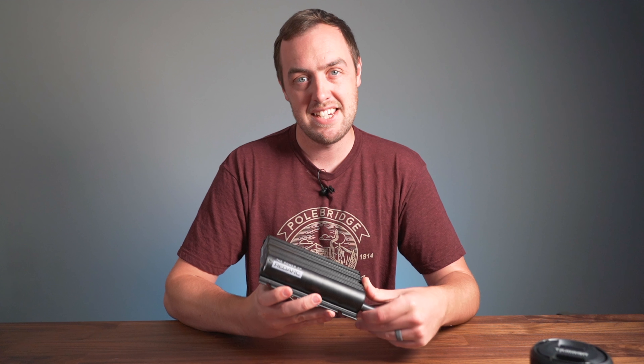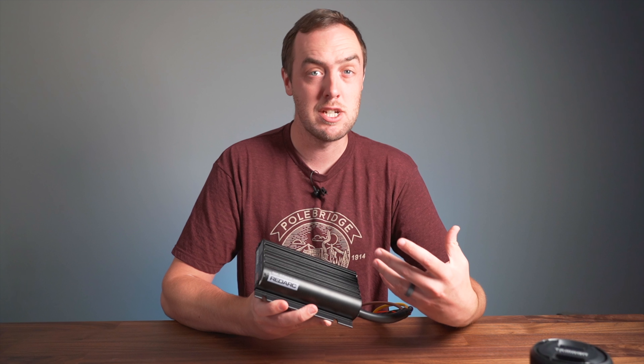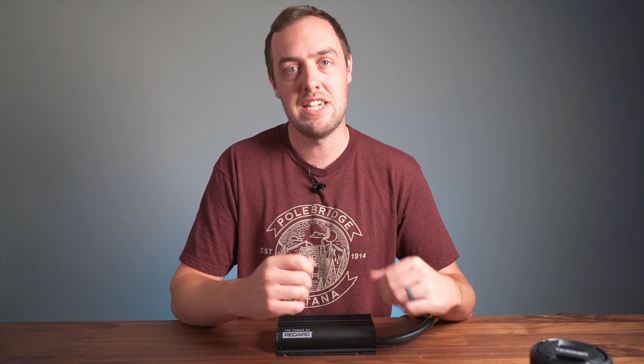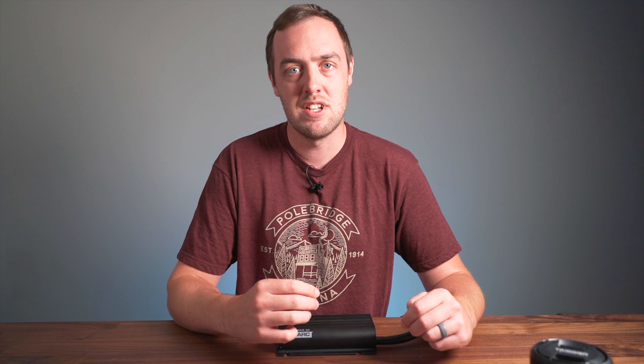For a dual battery setup, the best way to charge a second battery even if you are on a budget is with something like this — a DC-to-DC charge controller. This takes power from your alternator and uses it to charge your second battery. Because you're using a DC-to-DC charger, your second battery does not have to be the same as your starter battery, so you can just keep the starter battery you have, which means it ends up costing about the same.